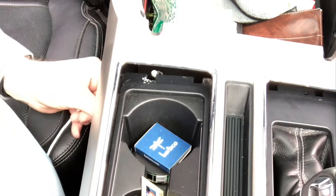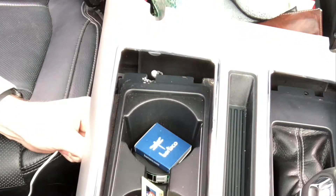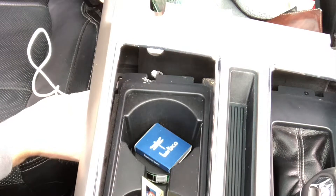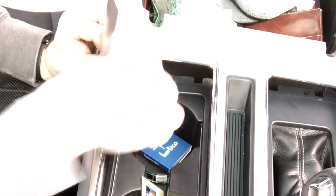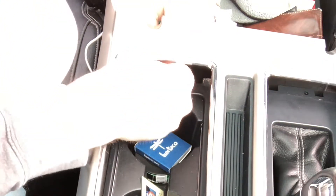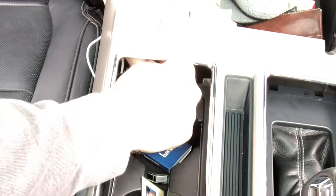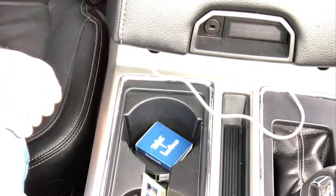What I've come up with is: we're going to lift this up and use one of these grooves right here to angle the drill bit down and shoot right in here — that's going to bring our wire out into the center console just below this lip which this slide tray sits on. I'm going to use that groove and slide right in there and go right underneath that clip. So now all I'm doing is running it along the groove inside of here — it kind of just falls into place. Now I'm going to feed it through my first hole that I made, pulling it through, then weave it around and feed it through this second — actually third — hole that we just made.